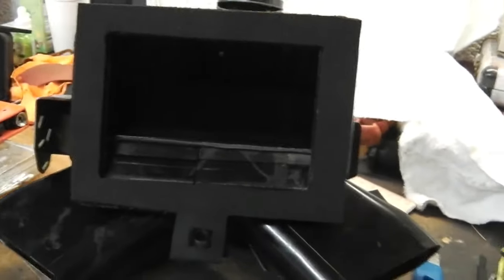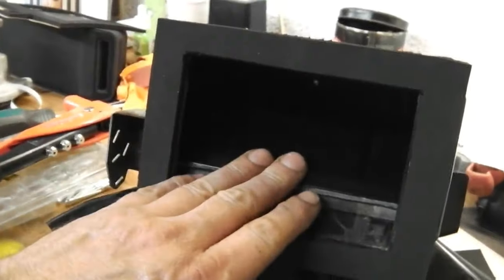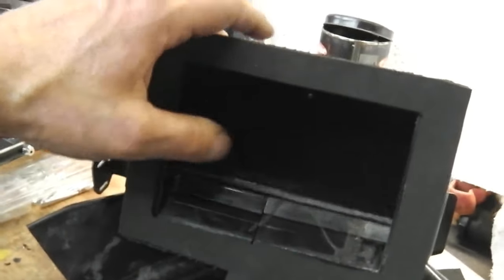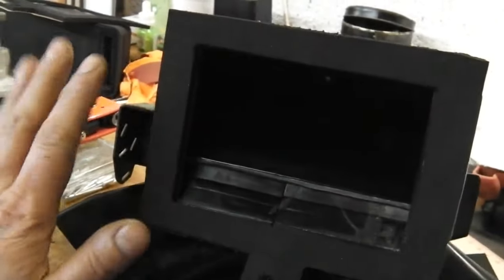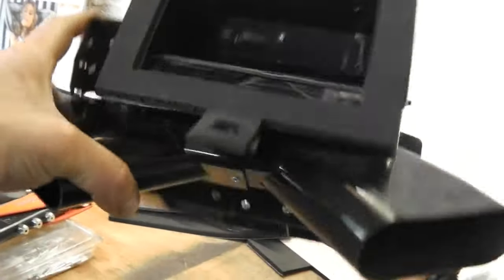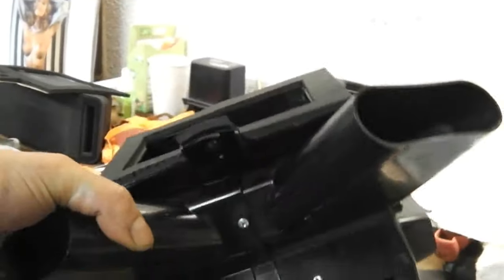And that's how it works. It effectively gives you a boost of air, which is the closest you get to aircon, and it's full fresh air. That's how it does it, by closing that lid down so nothing can get there. That's what it's for. So the lid, nothing to do with the heating, it's simply for full fresh air to your face. It effectively shuts this box completely off, isolates this box out of the air distribution. So that's what that lever does.